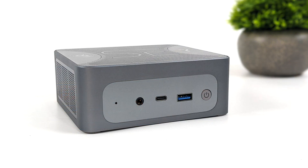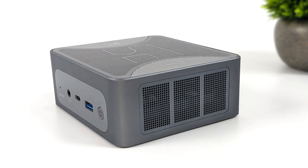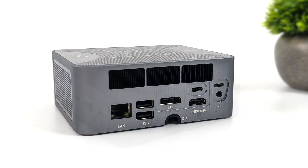When it comes to IO on this new mini PC, up front we've got a 3.5mm audio jack, USB-C — which is actually USB 3.2 — and a full-size USB 3.2 port. The sides just have ventilation. Around back, we've got a 2.5 gigabit ethernet port, two USB 2.0 ports, full-size DisplayPort, full-size HDMI, and two USB 4 ports — both of which will do video out. So we can do a total of four displays, utilizing the DisplayPort, HDMI, and both USB 4 ports. It's using the 40 gig protocol, so connecting an eGPU over USB 4 is quite simple.